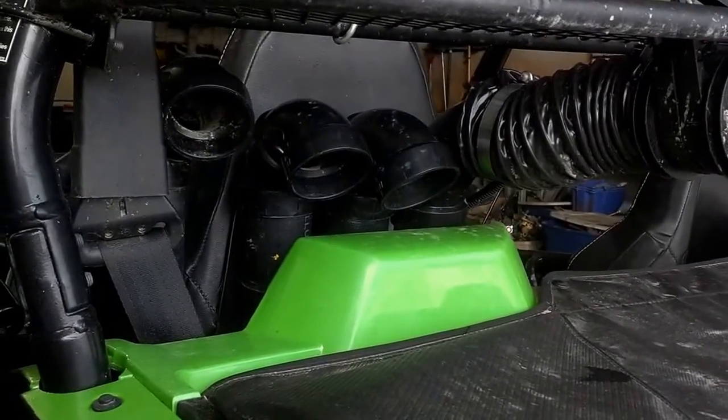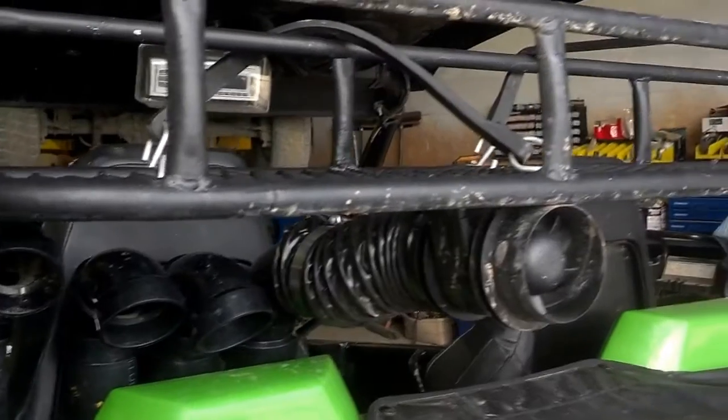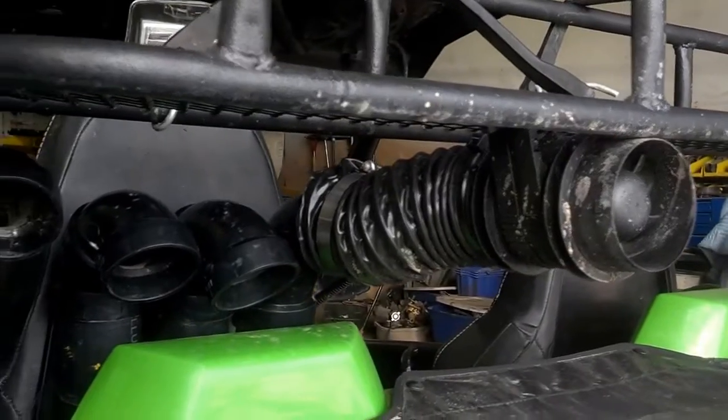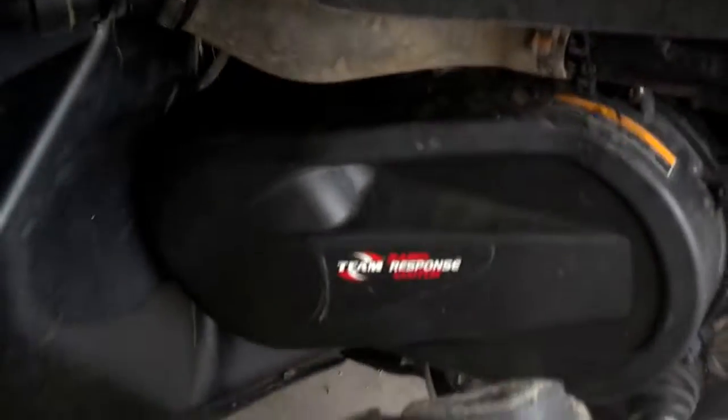I snorkeled it in behind my driver's seat. I've got two pipes running to the intake box and one pipe for the exhaust of the CVT. For the intake of the CVT I decided to put a bilge pump fan on just to give it more airflow for when we're doing some of the torquey or low speed maneuvers — it's put a lot of heat on the belt turning these tires in that muskeg and stuff. This pipe here runs down and into the air box to give it a second breathing point, because you're dropping down from a two and a half inch to a two inch diameter pipe, so I figured it'd be best to go with a second pipe.